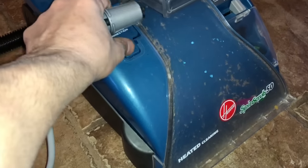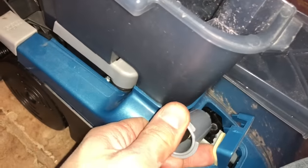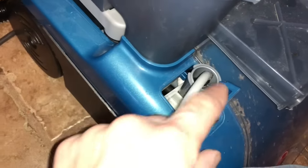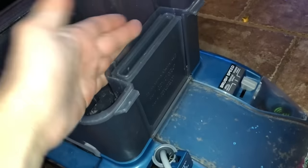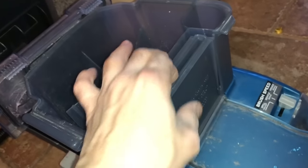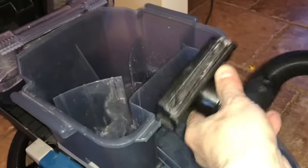Pull this handle back up — that will work. Put the handle back down. Unlock the dirty water tank and flip this up. You've got to push down right there — this piece actually overlaps that and locks it in place. See that? So now it's nice and tight. Now this piece flies up and out — you can't just flip it down. You have to pull it up and out. Get that in and lock this thing in place. Centered.